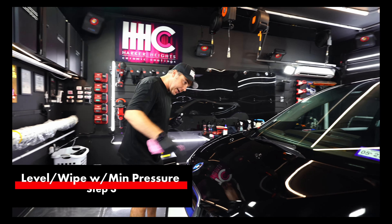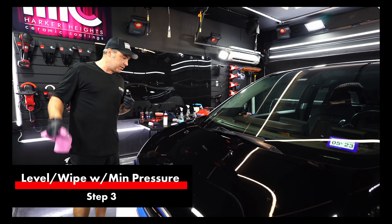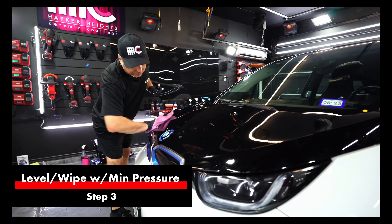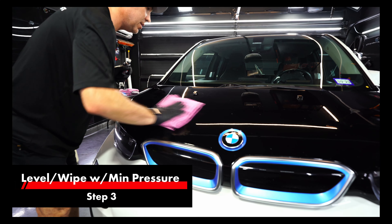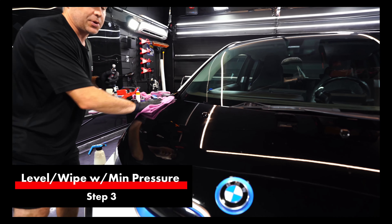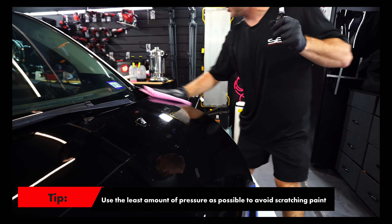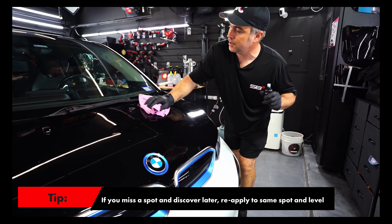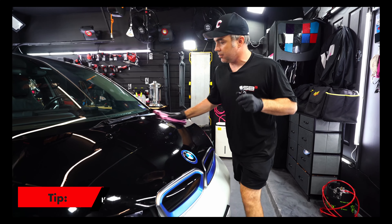So I've got my quadrant wipe. I can see a rainbow on my end, but we're going to give it another minute or so, and then we're going to wipe. All right, I see the rainbow, so I'm going to wipe. I love how this comes off — it's so easy to get off. A lot of coatings from other companies, if you've tried them in the past, you may find yourself looking from weirdly odd angles just trying to make sure you don't have residue. With SB3, the one thing I love about all their coatings — not just 33 — is that it's so easy to wipe off and really forgiving. If you miss a spot, sometimes you have quite a while, as long as you're not in a really bad condition area.